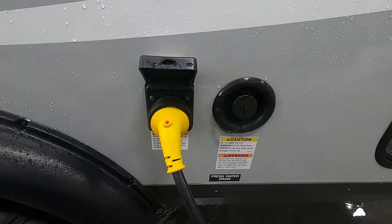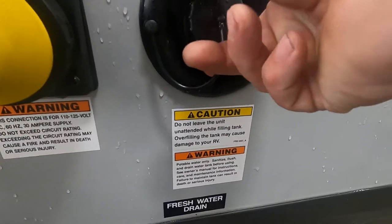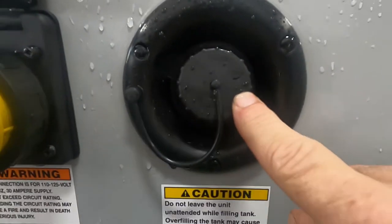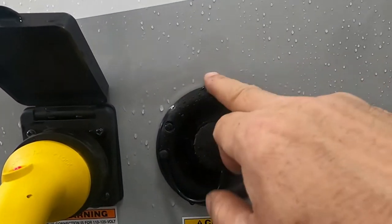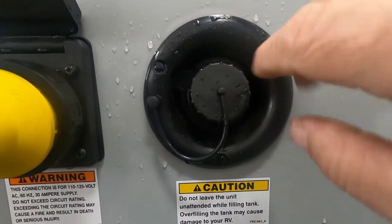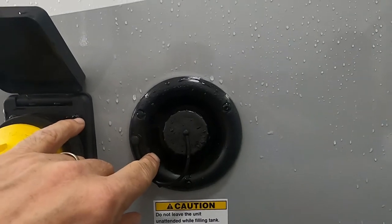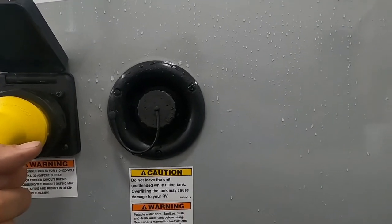Let's say we're going to use potable water and not use our city water connect — we're going to go dry docking. Right here to the right of your power cord is your fresh water tank. Simply fill this with a hose — no need to use your water pressure regulator. Open this up and fill it with the hose. Two ways to tell it's full: one, there's an overflow valve right here; or two, when you're on the inside and check your tanks, there's a button for your fresh water tank to tell how full it is. Just remember, when using potable water you're going to want to turn on your water pump. Don't use your water pump when you're using city water — it's already pressurized.